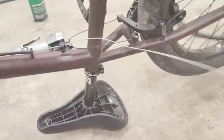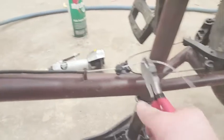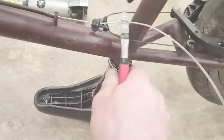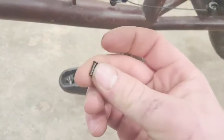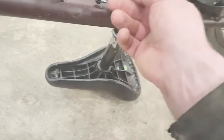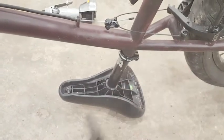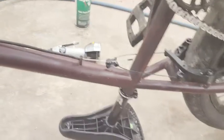Everything's good. I just put that end piece right back on there after cutting off about a foot and a half or so. As you can see I've got all this extra wire here, so all I'm going to do is just snip it off right about there, because I don't want it to go past that tube right there. They actually gave me a little cap here — I assume that's what it's for — you just slip it on there and give it a crimp with the crimpers on the end, or whatever you have that works, just so it doesn't fray any further.